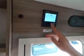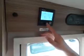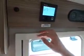The only difference between ones and twos is the amount of electricity going to it — one kilowatt or two kilowatts. Think of granny's old electric bar fire: one is the one bar, two is the two bars. If it's the middle of winter and you're really cold and want to heat up the quickest way, use mixed two — that's gas and two kilowatts of electric, the fastest the system will heat up.